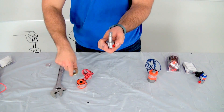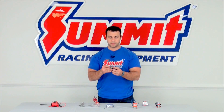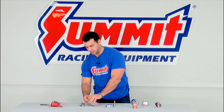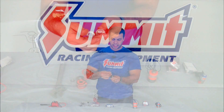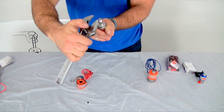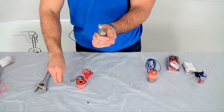If you look down at the plunger system and the base, you'll see that there are two holes on the stem of the plunger at the base. Those are for a spanner that actually comes in your rebuild kit. Go ahead and open up the spanner, slide it right over the base, and you can use your adjustable wrench to spin off the stem of your nitrous solenoid.